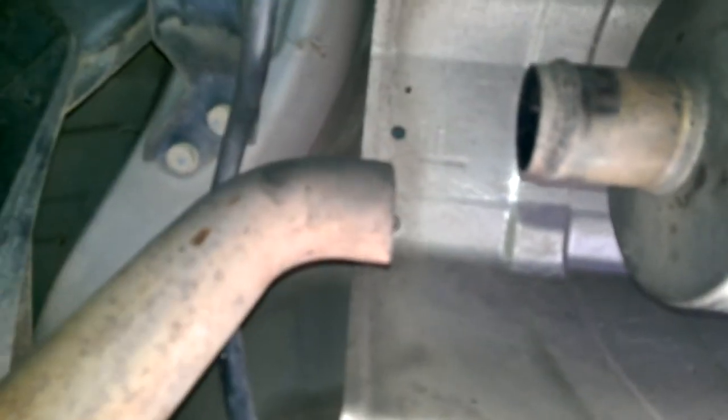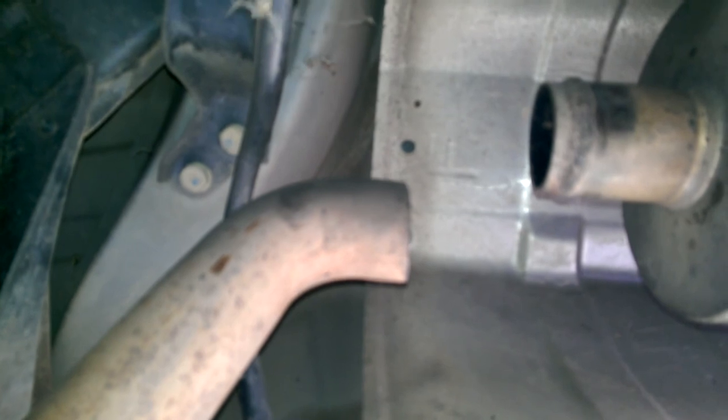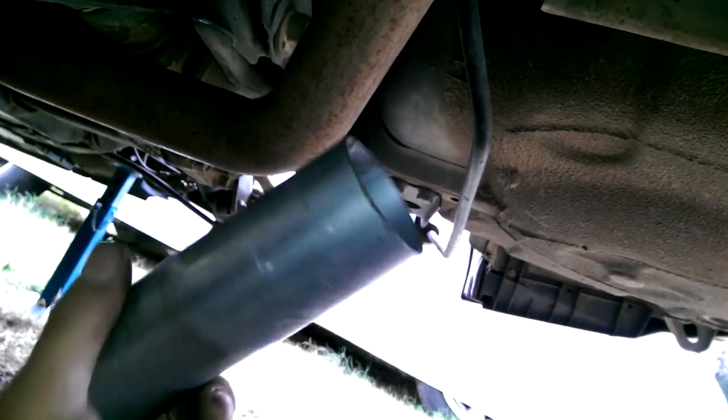We have a real problem because it might look all right from there, but it's a bit far off. So not only do we have a bit of length to fill in, we have a bit of, well, that length. So I've already been in the muffler shop, got a short piece of 2-inch pipe. What we're going to do, going to cut it here and here. We're going to rotate that and then stretch that out basically till it works.